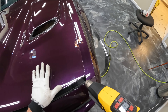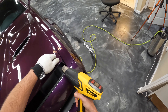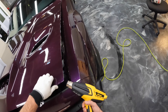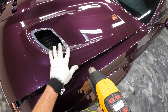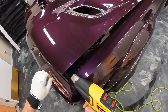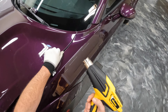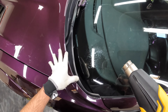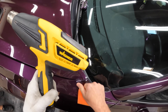On these edges, because I left just a tiny bit hanging over that corner, I put a little bit of heat on it and wrap it under. Then you're going to have a really nice edge where you're not going to see the edge of the material on that corner, and you won't have a bunch left over to bunch up underneath while you're trying to wrap it to the underneath the hood. Heat sealing the edges is really going to lock the material down and keep it stuck, so you end up with a lot less issues with it popping up over time. We heat seal every edge every time on all of our installs.